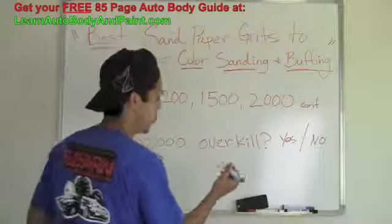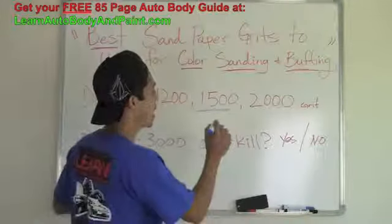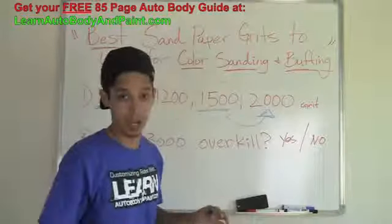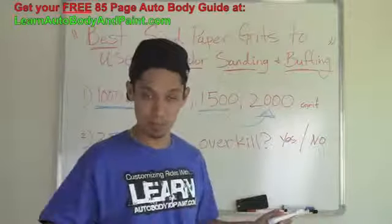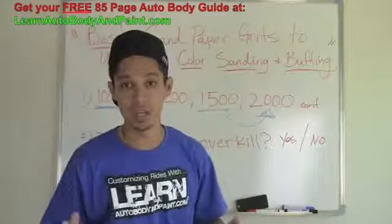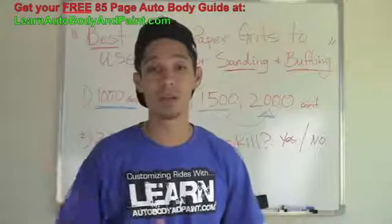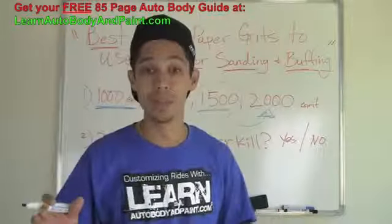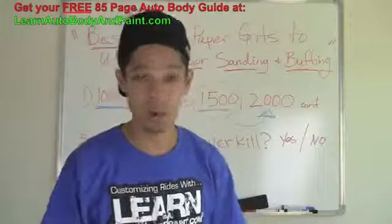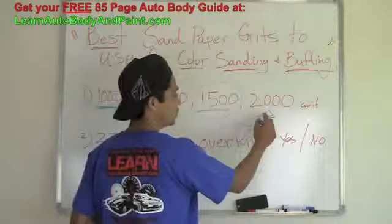So what I like to do is dry sand with a DA at 1500 grit. If you're not experienced, I would go with 1500 wet sand and then move down to 2000 grit — wash it, get it all flat, smooth it down. Make sure you're buffing over 2000 grit, and then go ahead and use the one-two-three stage buffing steps we show you on the website. It's all in the VIP training course and we have thousands of members with full support, so you're not alone with your projects.